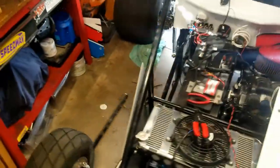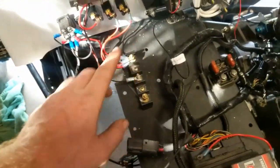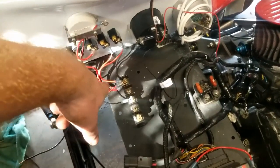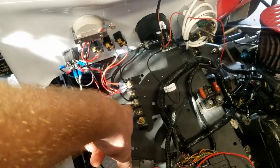So I'm working on the rest of the wiring. One thing I want to point out — the way I do it is I like to have one central point for everything. My ignition switch when it goes hot, I want all my powers on one stud — basically one board or one circuit. Same thing with my grounds.